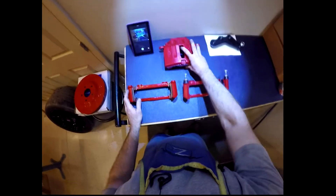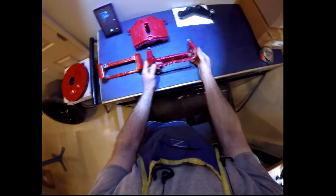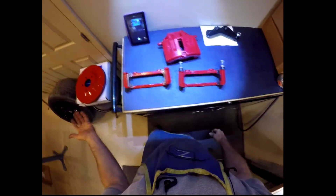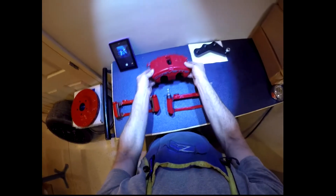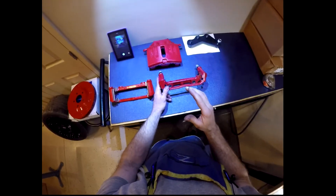One note: if you do buy this caliper brand new, it comes with brackets — this is the heavy duty J55 bracket, I think they call it. Basically this caliper allows you to run a 13 and a half inch rotor. I have 17 inch aftermarket rims on there — Z06 style — but I didn't have clearance; up top there was some rubbing so I could not make them work. So if you're going to run this caliper with the 13 and a half inch rotor, you'll need a minimum of an 18 inch rim.